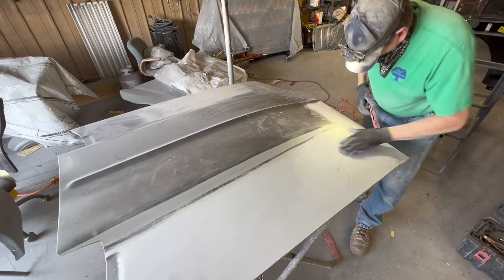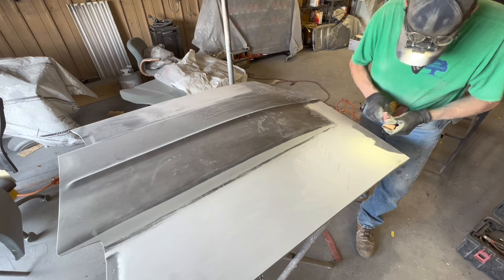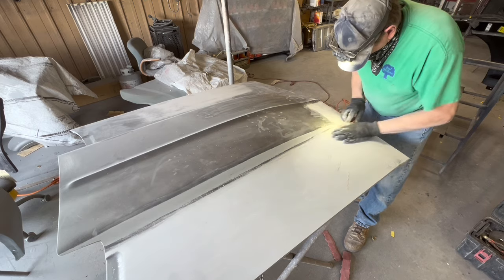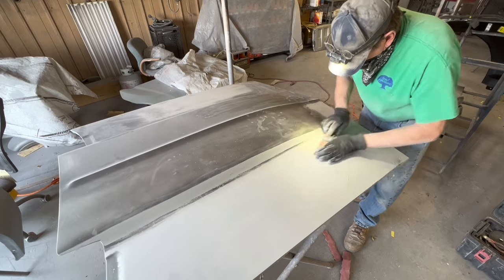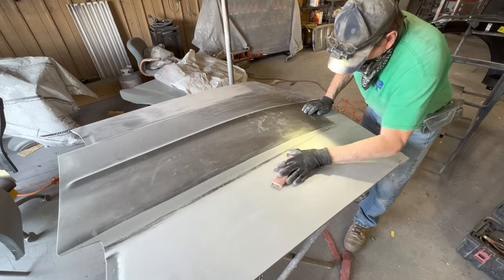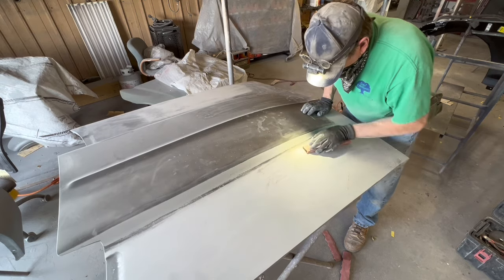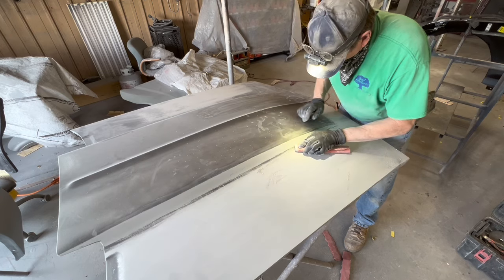It also can be a symptom of overly cheap product. I don't buy a cheap Bondo for the cars I'm working on that I expect to be nice. If you're doing a nice job, why would you think something cheap would be good enough for it? Now, I'm not one of those morons that think you have to buy a $100 gallon of Bondo for it to be any good. That's just plain stupid. You're fixing low spots and leveling things out with Bondo. It doesn't need to be a mixture of Bondo and high dollar glaze. It can just be smooth Bondo.